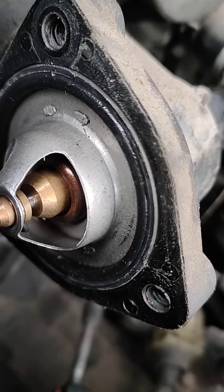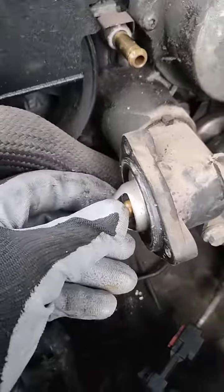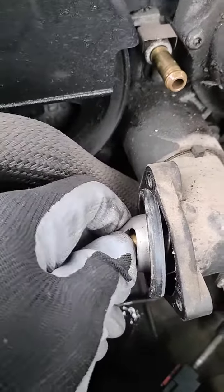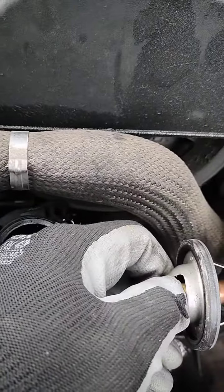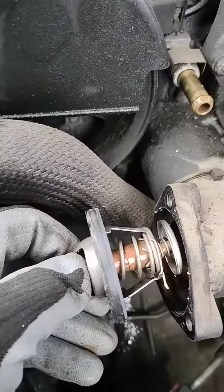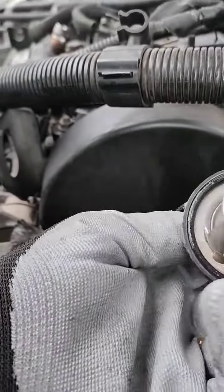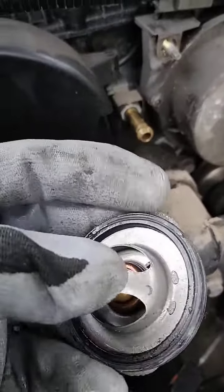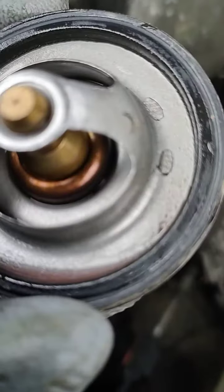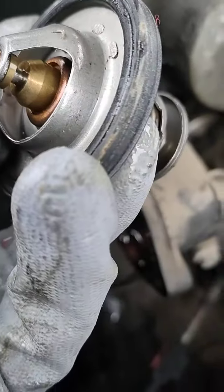I remove it, and I was speaking about this rubber — if this rubber fails, sometimes your coolant will keep passing and your engine will not reach the right temperature. Also, notice how it was positioned. You see that little hole there? It's very important — very very important. It should not be down; it should always be up, like that. Okay, see you, bye — like and subscribe!